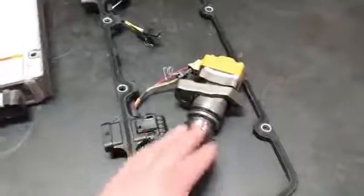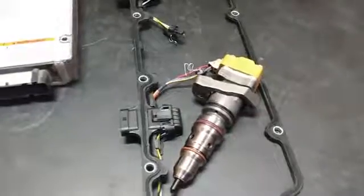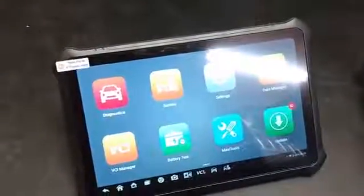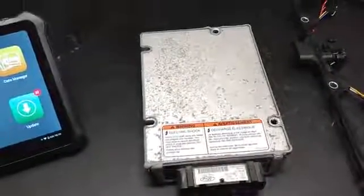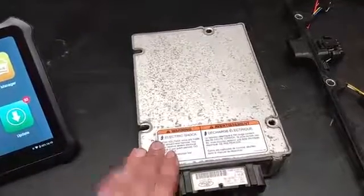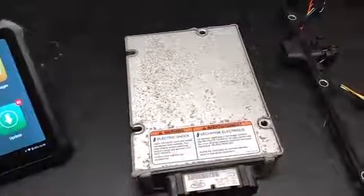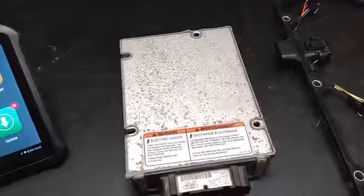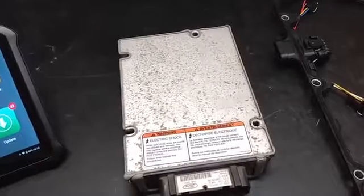It really doesn't do anything for testing most of the mechanical portions of the injector. So the Buzz Test uses the scan tool to command the injector drive module to electrically oscillate the solenoids on all eight injectors. When you hit the button to command the test, the IDM will first command all eight injectors to buzz at one time — you'll hear one loud buzz. Then, very important, it will command the injectors to oscillate one at a time in numerical order.